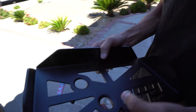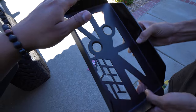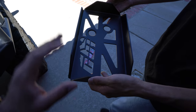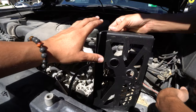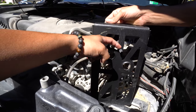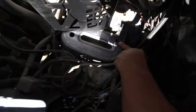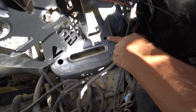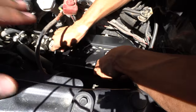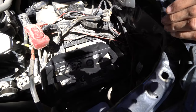For the new battery tray, CBI off-road makes these which are super clean. It actually has walls on each end so that'll keep the battery in place from shaking around on your trips. To install this, on the bottom end of the bracket you'll notice there's a pin, and that's going to be installed down there — it kind of slides into position and just helps lock it in place so it's not moving around. As you can tell now, it's nice and sturdy.